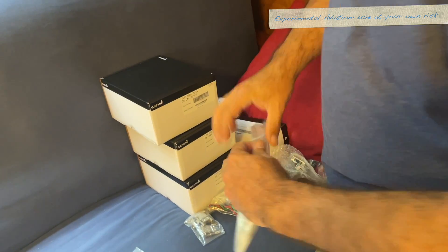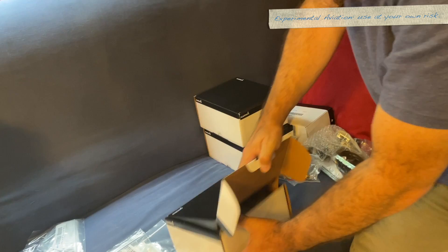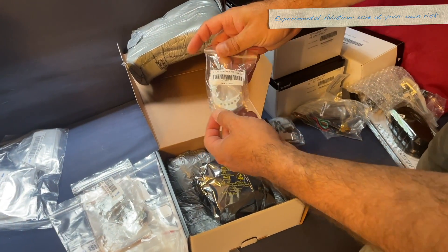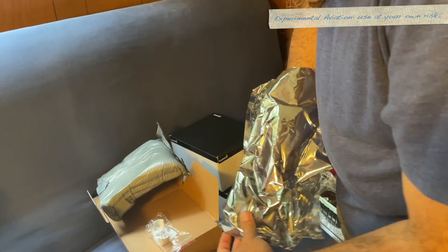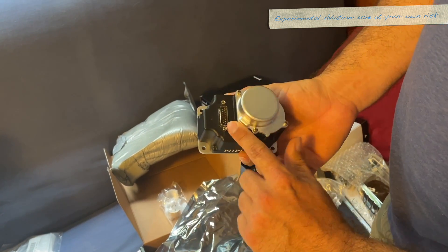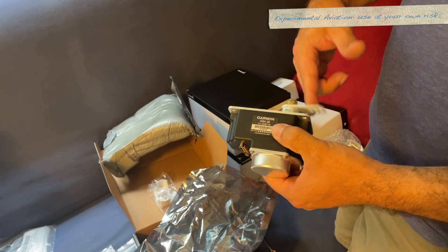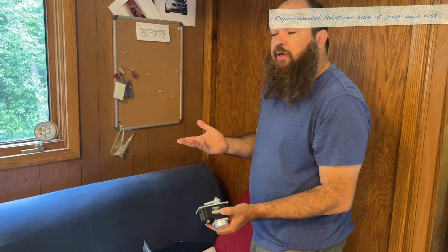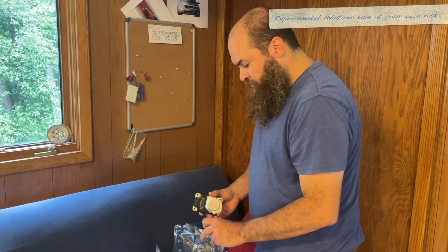Let's open this up. There's the little bracket so that it won't move past center — and here is a servo. Pretty nice. It's one of the few mechanical devices in the kit. Just one connector on the back and a little arm. I really like that these servos have internal clutches so it's really smooth and it's not adding drag into your control surfaces. There's no shear pin — you just set the clutch torque as part of your checkout and configuration, so you can overpower it, it senses that you've overpowered it, and releases. Nice little servos — they're tiny. All of this stuff is smaller than expected.